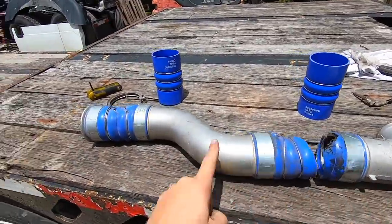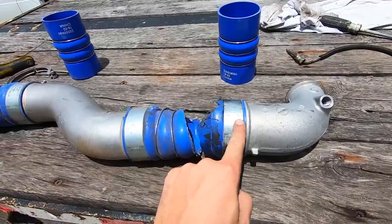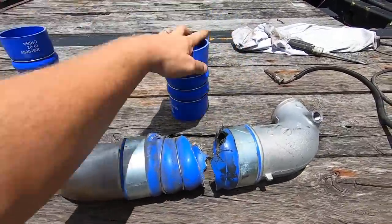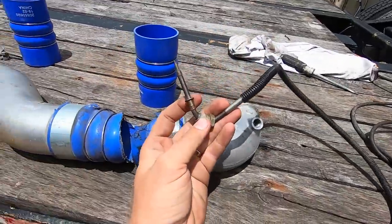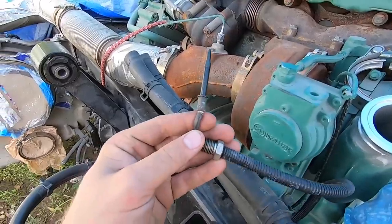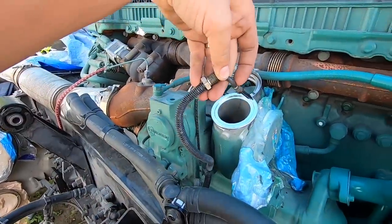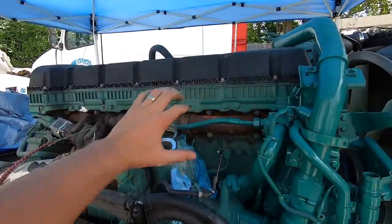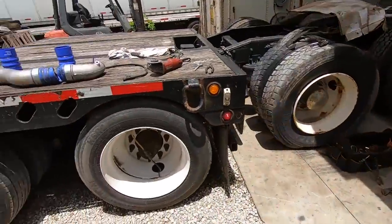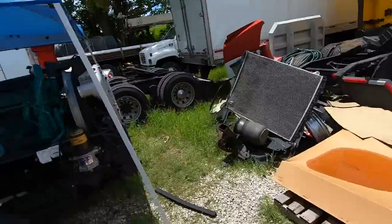So what are we going to do with this pipe? We are going to cut these tabs off — one, two, three, four — and put regular clamps on here. That's how you replace this right here. I also went to my junkyard guy and got a new sensor. This sensor comes right there — let me show you guys. This is my sensor right here and it is damaged. When the impact hit it kind of bent and broke it right there. It's plug and play down there. I'm going to go ahead and grind these tabs off, replace the couplings, and start installing this.